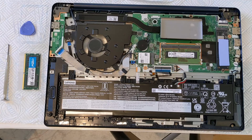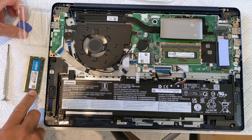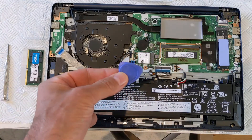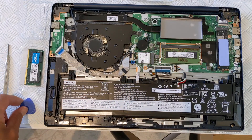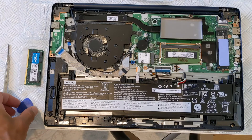This is the 2021 AMD CPU-powered Lenovo IdeaPad 3. I've removed the 10 screws that hold the back on, and then using a plastic tool, I've removed the plastic back cover. Be careful not to break the edges of the plastic back cover — that will be quite easy without such a tool.